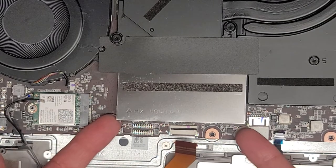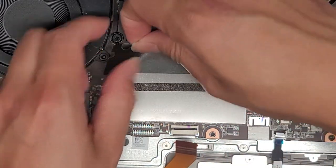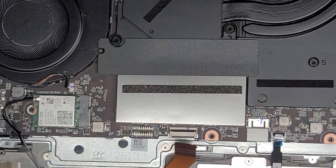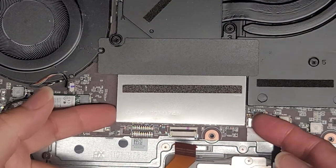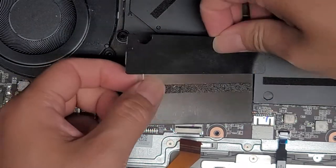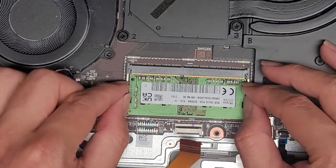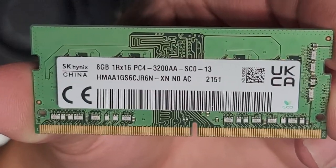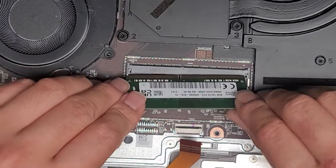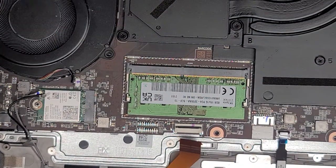We're going to look at the RAM. I just get underneath this metal box and kind of pull it up. There's plastic stuff on top holding it down, so let's peel that up as well. We got the RAM — 8GB PC4 3200AA. Should be fine with any PC4 3200AA RAM. A lot of times the motherboards will take any PC4 or DDR4 RAM, so you might not have to stick with that exact speed.